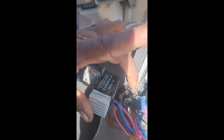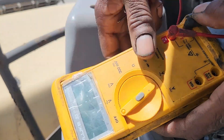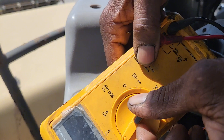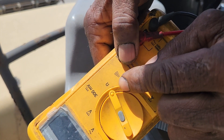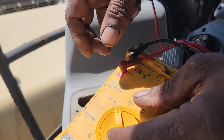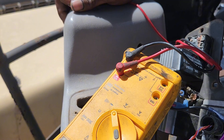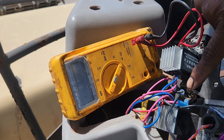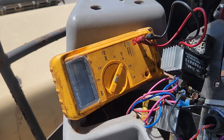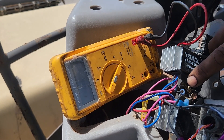Let's get a wire and we'll test that theory. Let me get some wire and I'll be right back. Got my trusty old Fluke here. We want to put it on continuity — you test here if it's good, it's gonna be zero. You put it here, it doesn't make a sound; a complete circuit you'll hear that beep. What we want to do is check this switch right here and see if it's good, so when I put it down, this one should be connected to that one.